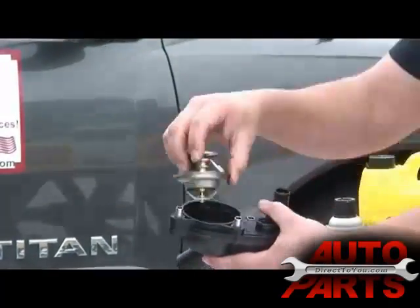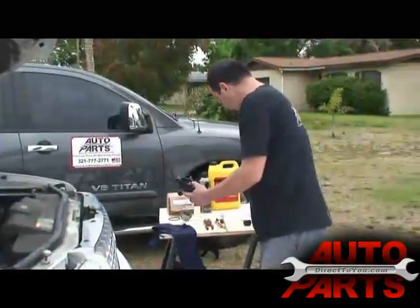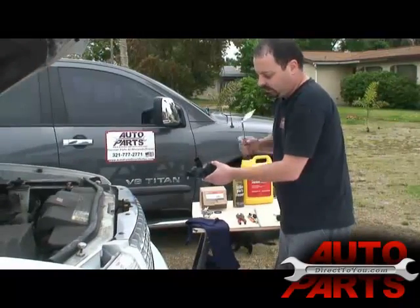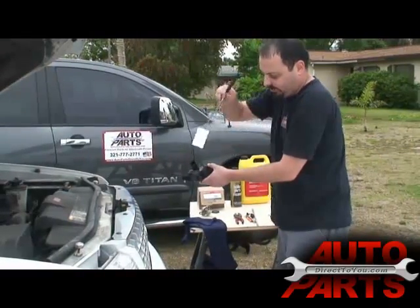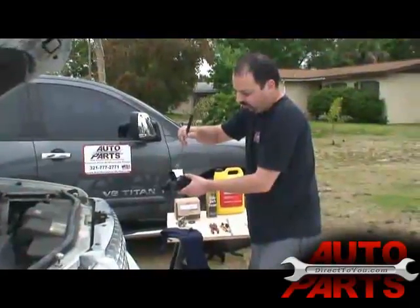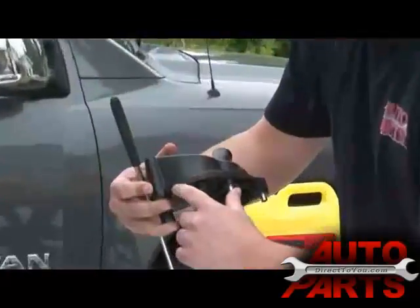Where it was leaking — we took a mirror, because this is how it would look to you if you were looking on the vehicle. The leak was on the back, so we put the mirror right behind it, and you could actually see this seam right here is where it was leaking. So with visual proof, we knew what to go after.